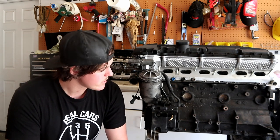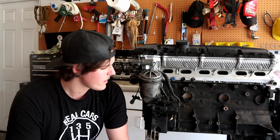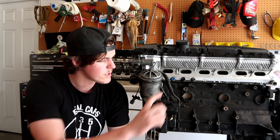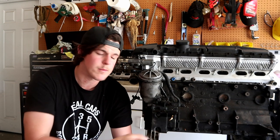We are gonna be replacing the power steering pump at some time to prevent it from doing that more, because ATF is kind of a dirty fluid, and it catches on fire if it gets super hot, which is not something you want from a drift car. So aside from that, the power steering system can leak from the rack seals. Usually you'll see the boots on the bottom of the steering rack get wet. It can leak from fittings from the reservoir, so they just have little hoses that plug in. You've got clamps there, so you can reclamp those.